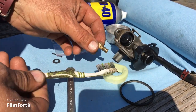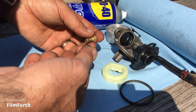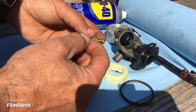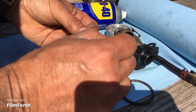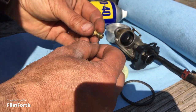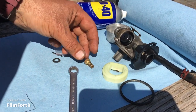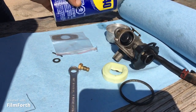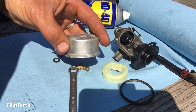After about two hours in the vinegar-water solution, just use a toothbrush and clean it up a little bit. This guy here, which is the bristle of a wire brush — make sure you get the two little holes, they're very small. Make sure you get those clean. Then use air pressure and WD-40 as well. There you go, clean that all out.